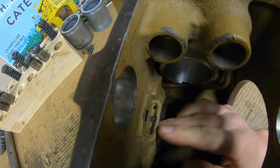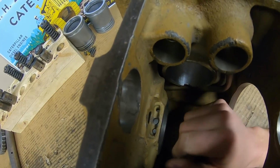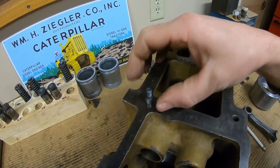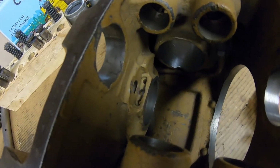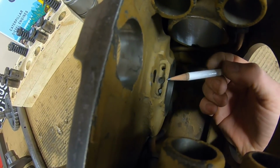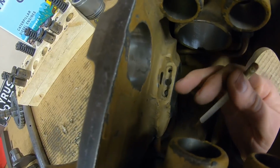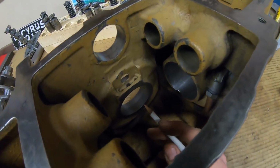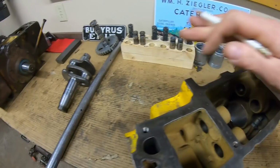So once you press a bearing in and then it opens up even more, you're guaranteed that the old straight dowel is not going to ever stay tight. That's not a big deal. We'll put one of those in there, so that pretty much negates that. So because the outside eighth inch or so of this bore is compromised with that crack in there, it's not going to be a super tight press fit out there anyhow. This is the perfect candidate for me to go in with my boring bar.